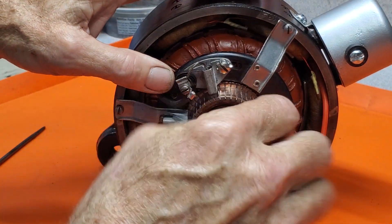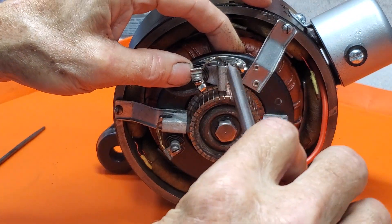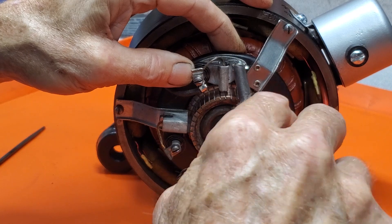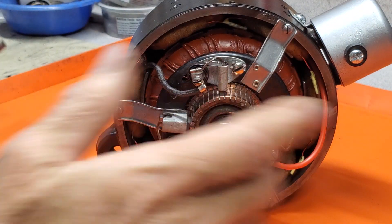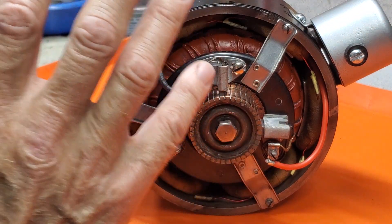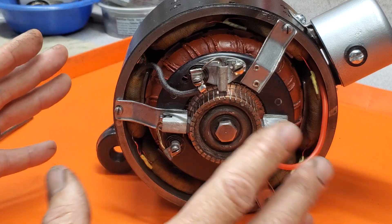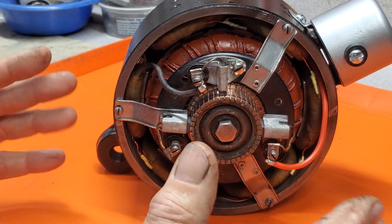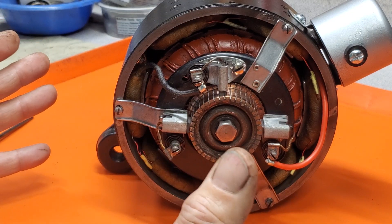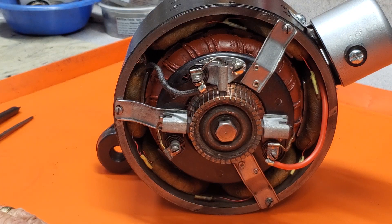For normal use what I suggest is supporting the back of the ring, loosening that screw about one turn, and then sliding the brush holder in this direction, which is going to reduce the output and give you the lowest output. Then snug up the screw — don't over-tighten it, just make it snug. Now the brush holder is locked in that position and it's going to put out probably eight to ten amps there. Don't be afraid to adjust your generator. The Ford owner's manual told you to adjust it to meet the load, and dealerships and mechanics would adjust them for you also. But if you're just normally driving, or if you have LED lights, just have your output set to its lowest setting. Look at your ammeter and you should have just a slight positive charge.